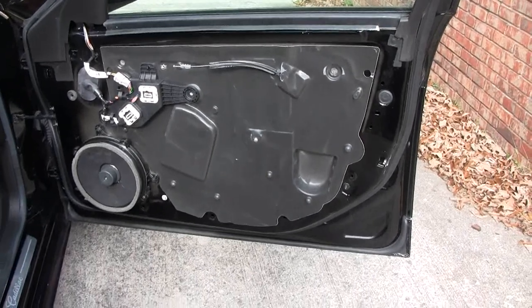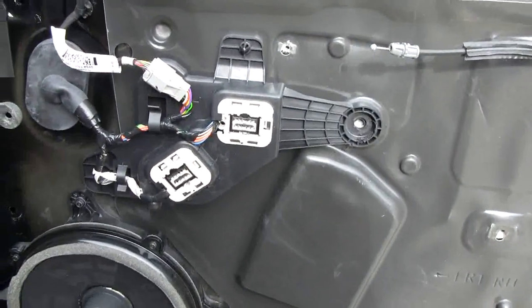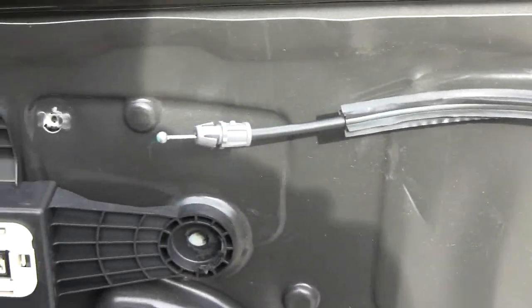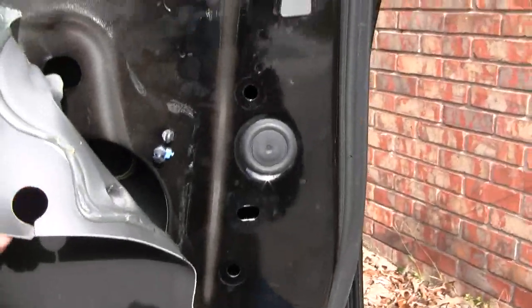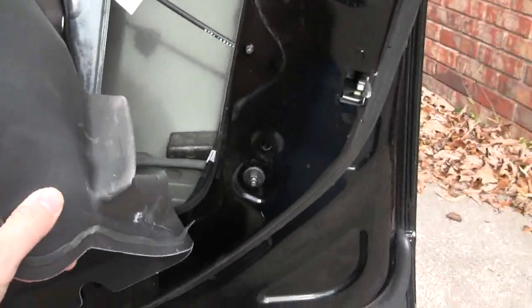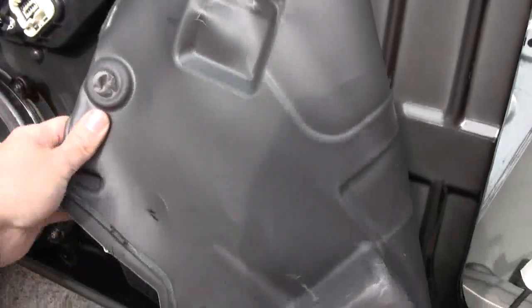Here's the door with the panel removed. The great thing about this design is that, except for the locking cable, all of the other connections are right here. Once you pull the door out, it automatically disconnects them — you don't have a bunch of electrical cables to disconnect. It's just the locking cable you have to deal with. Next, in order to gain access to test the switches, we need to peel back the rain shield here. It's just got some glue, and if you're careful, you should be able to pull it back without tearing the liner and leave the glue intact so you can stick it back in place. Get the lock cable out of the way — it's handy to just fold it back and stick it to itself.